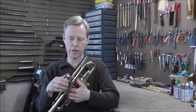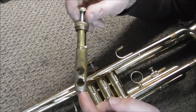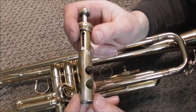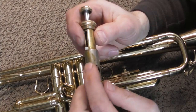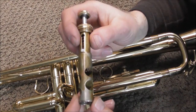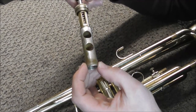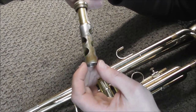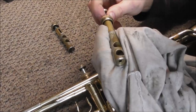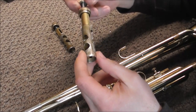Here's the third valve. You can see that there's a lot of discoloration on the valve, and it's not supposed to look that way. I'm going to take a rag and wipe that off. The discoloration is not a substance that has gone on the valve, but it's the metal of the valve itself that is being discolored, and that is most likely happening from oxidation. Looking at the valve carefully, it looks like about the only thing wrong is the discoloration. Here's the second valve — pretty much the same thing. I'm cleaning the oil off of that, and again about the only problem I can see is the discoloration on the valves.